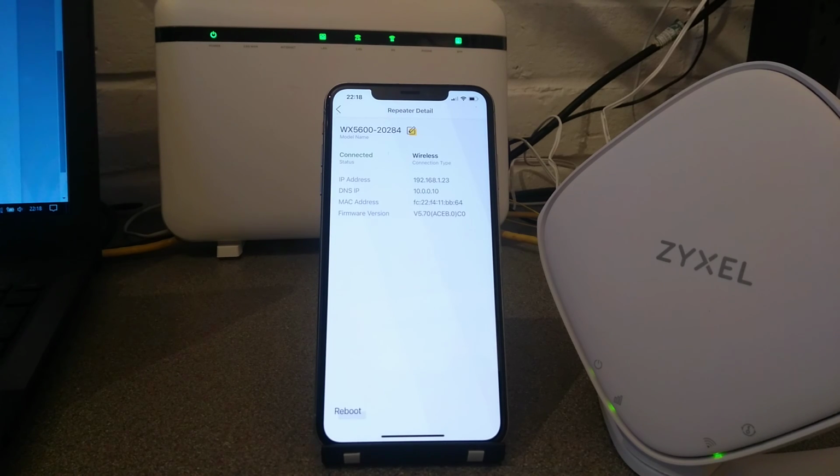If you click on Wi-Fi settings, it will let you change Wi-Fi, but I'm not sure whether it changes across all of the devices. You can set its LAN IP address. You can load certificates onto it, which is not much use unless you're doing TR069, where the router reaches out to a secure web page. It does have a log screen, which gives you details about devices associating and disassociating, and their rates, it looks like.